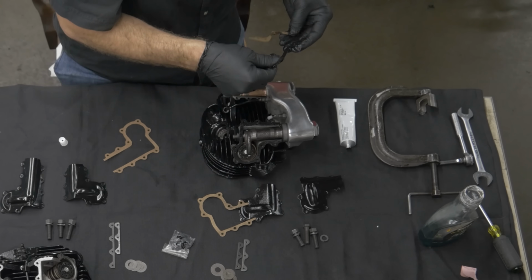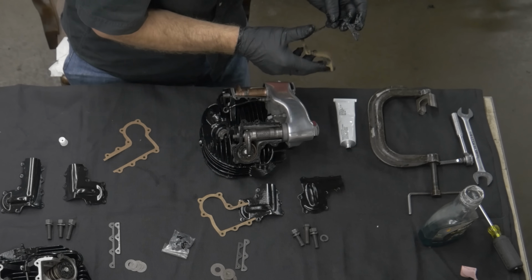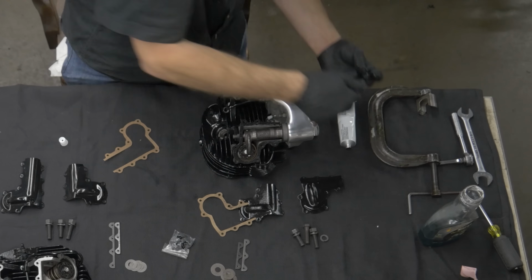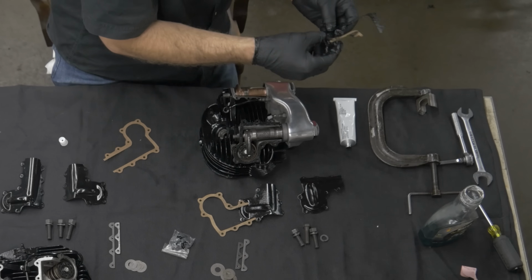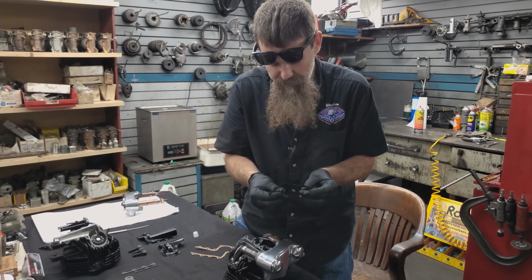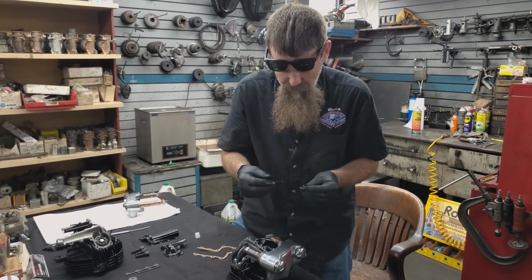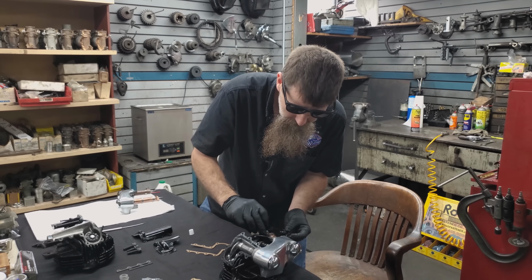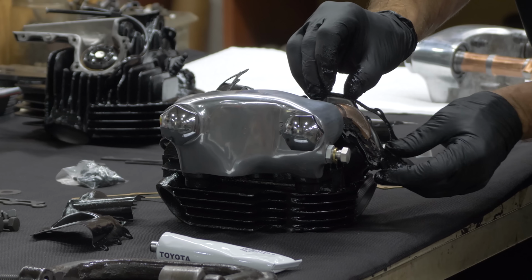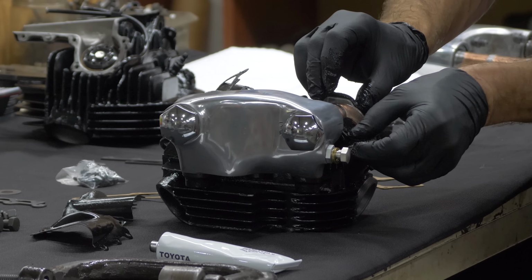One of the things about the Knucklehead, and by the way, guys, I did forget to mention the '37 heads, and '36 and '37, they actually had partially exposed rocker arms. Kind of a messy setup. So by 1938, they offered a retrofit kit to be able to outfit your earlier Knucklehead with the later style valve spring cups. And really a preferable setup.